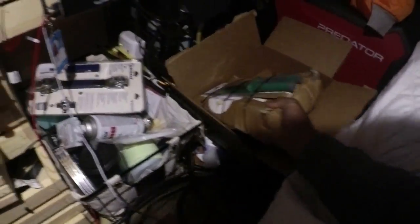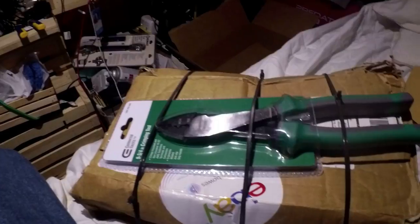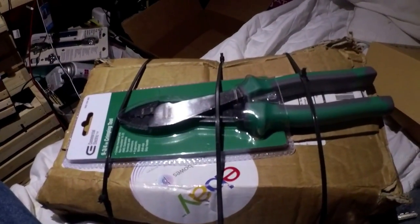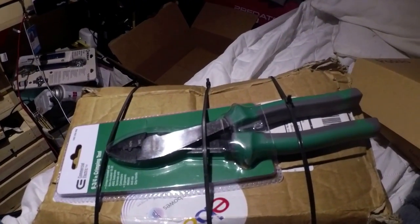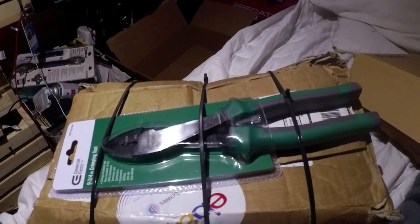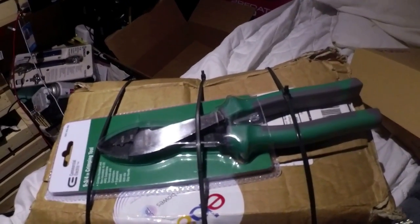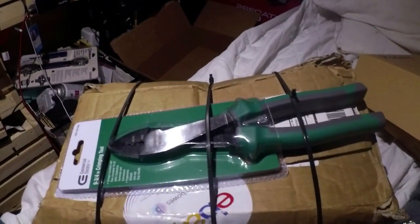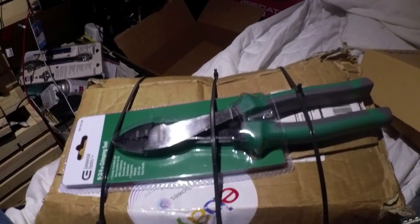If you've been watching my videos a while back, I've got this split charger. The majority of people in the States have used the solenoid type — when your engine is off, it either establishes or breaks the connection between your main battery and the battery in the back. This is the one I showed you that has a relay, which determines if you're above 13.3 volts and knows you're in the alternator zone. That's very smart, and you don't have to do all that screwing around with solenoids and fuse panels.